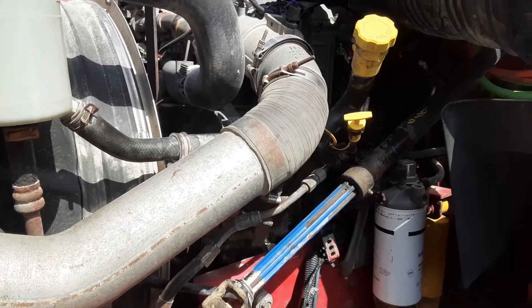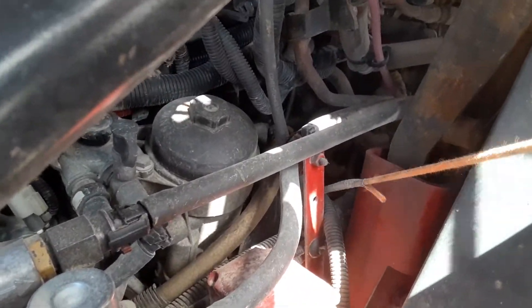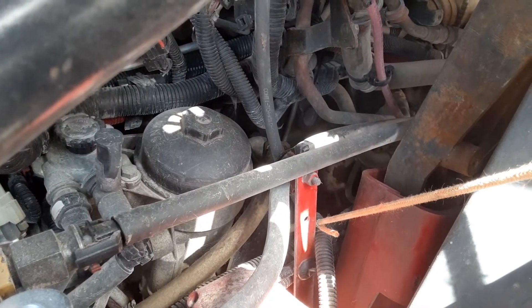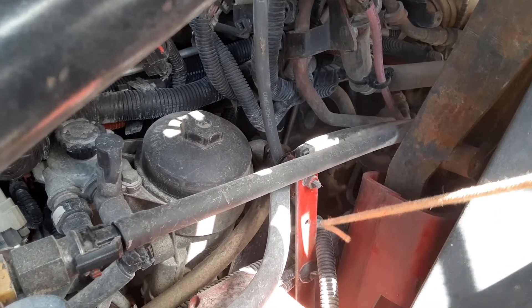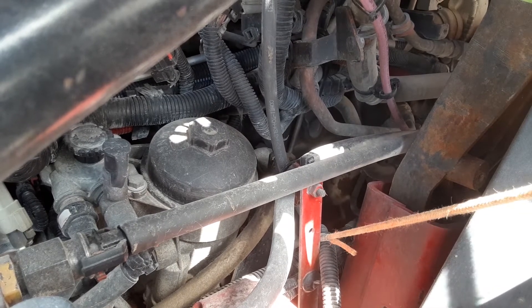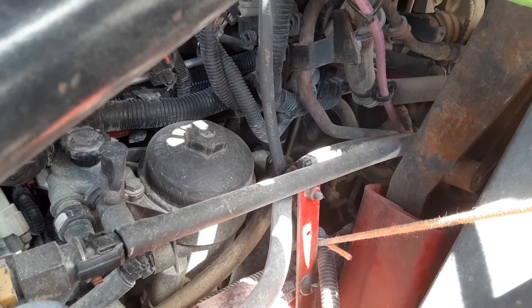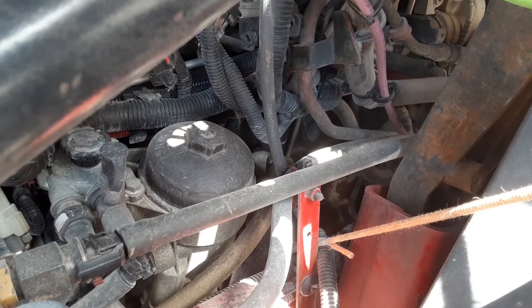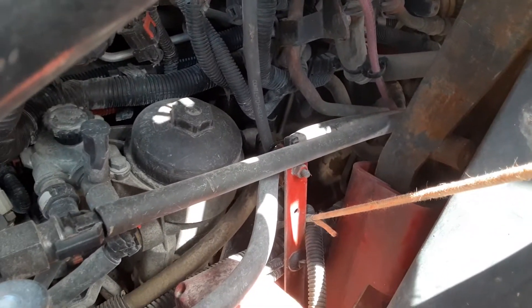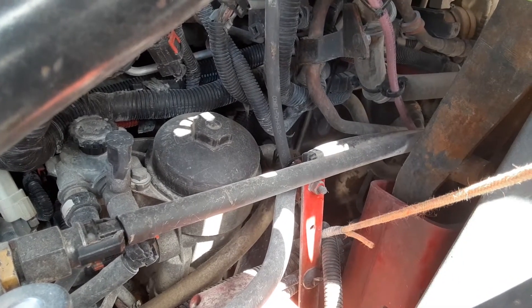Back here I call it the MAP — it's behind the frame and you cannot see it. The M stands for main airline: make sure connections are tight on both ends, no holes, no leaks, and not rubbing on anything. Your air compressor — it is gear driven, all the nuts and bolts are in place and tight, and it is not leaking. Your power steering pump is also gear driven — all the nuts and bolts are in place and tight, and no leaks.